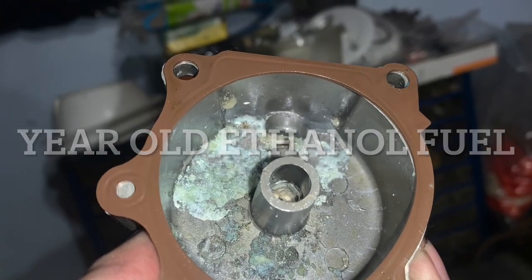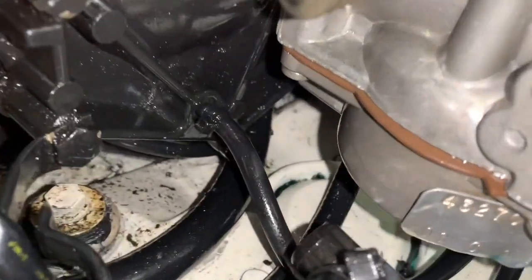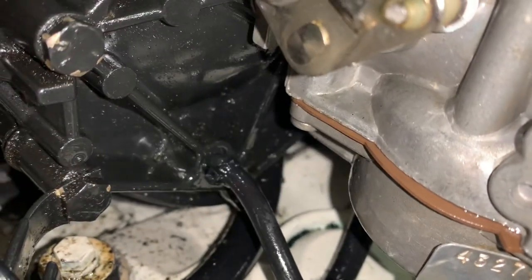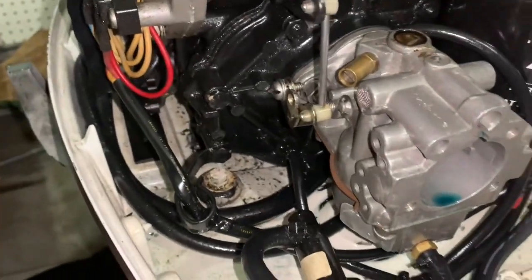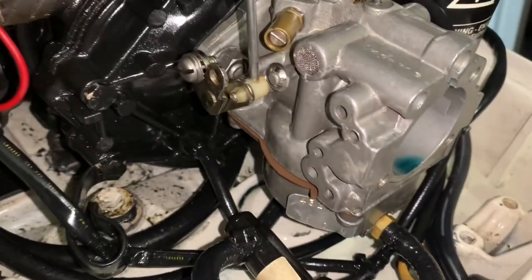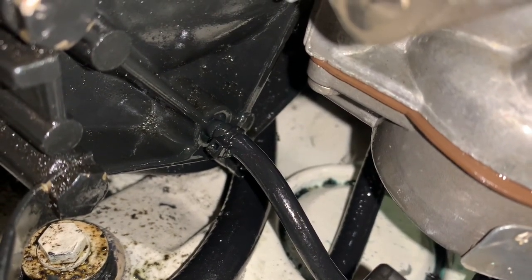Previously on Live to Fish Outdoor Repair — one thing I noticed: if you look down here as I pump the primer, it's spraying all out. I didn't notice that before. Over here you don't see it so much, but when you really pull on that primer I've got a nice leak, and that could be creating a problem too. So let's start this back up after I fix this leak and see what happens.